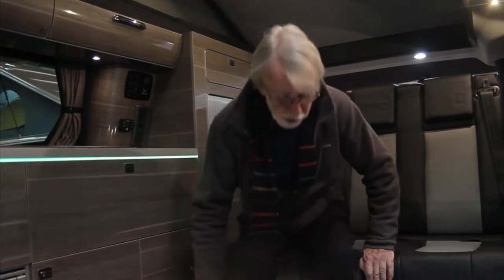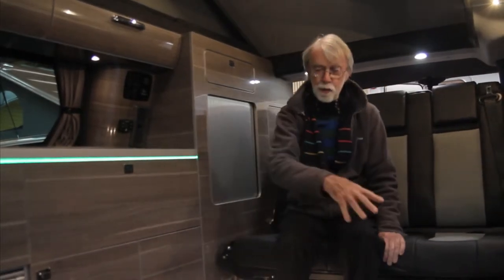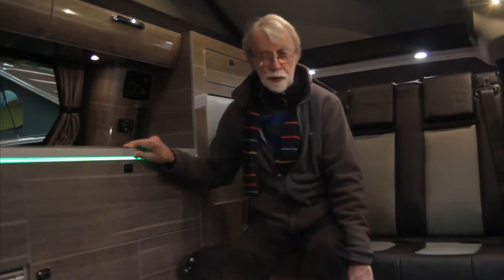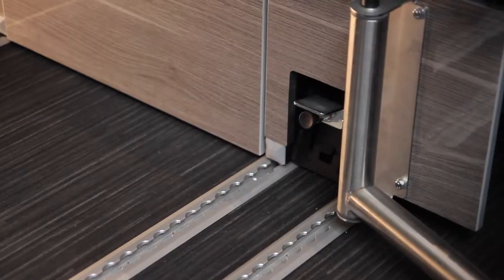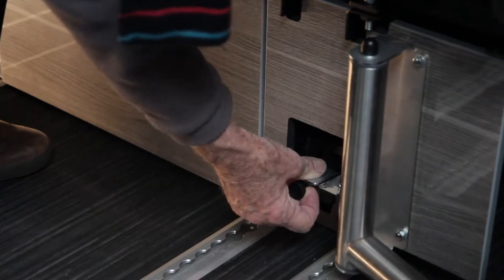The seat and bed arrangement is from a quality German manufacturer and fully meets Ford safety standards, with Isofix attachments for baby seats. Mounted in very secure floor-mounted runners, the seat moves forward to the desired position. If you want to eat with five of you at the table, position it here. If you want more space in the back, you can move it right to the back, giving you an enormous amount of load space in the front. And of course it folds down into a bed, in which case you move it forward to the right position again. Once you've decided which position you want, especially if you're travelling, it's important to lock it securely. Simply find it in the right place, operate the foot pedal and it's locked. To release, press down on the pedal, pull the lever and release.